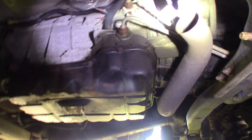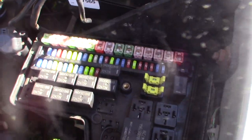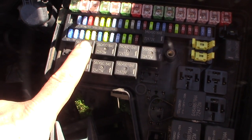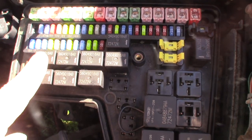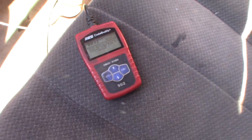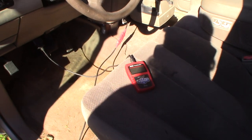Now it's time to get out the old power probe. This box here with all the fuses and relays controls the engine. I switched the ASD relay — Automatic Shutdown — which shuts down if you hit something. If that relay doesn't work, you don't start. So I swapped it and I'm going to give it a try. I tried reading another code — all I got was the same P0032, which is probably because the oxygen sensor is missing since they stole the cat.